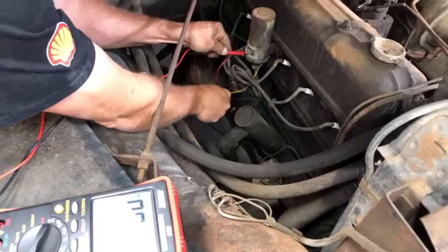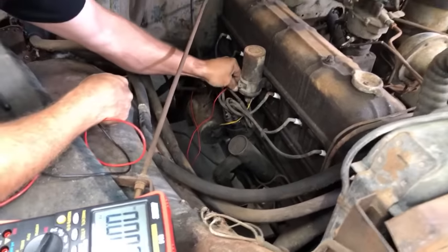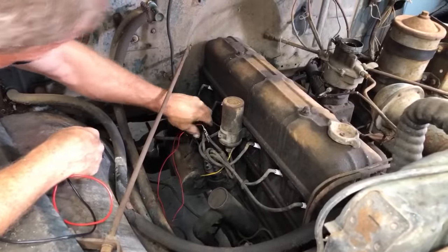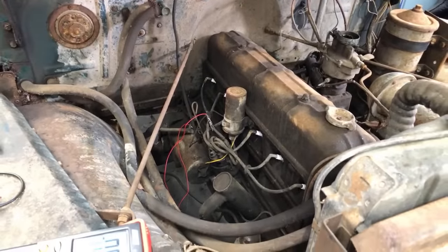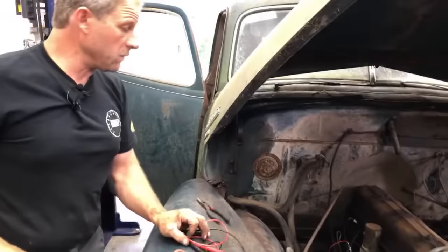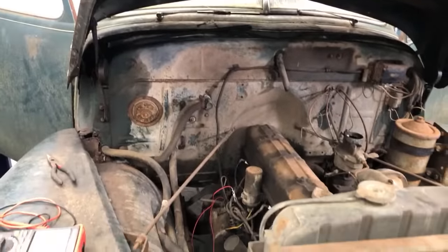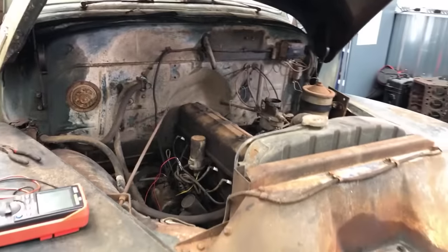Okay, stop — let's look and see if we have any spark. Go ahead and crank it over a little bit. It looks to me like the coil may be dead. Try cleaning up where the positive is hooking to it. When I did the test earlier I had to really jab it in to get any progress. We could check voltage across the coil — that would tell us real fast if we have a bum coil. I have a 12-volt coil but I don't know if that'll work on this six-volt system. Looks like we got an open coil — no volts.